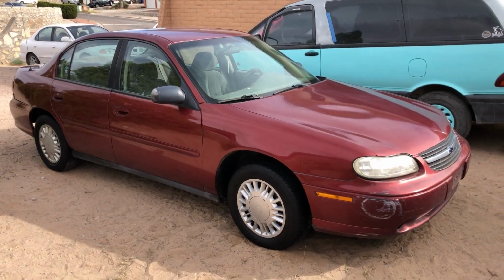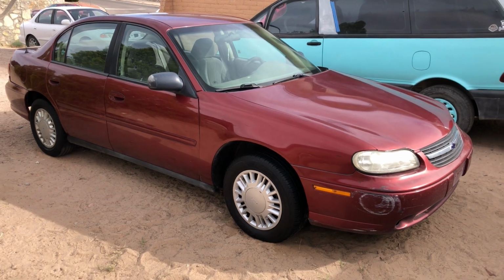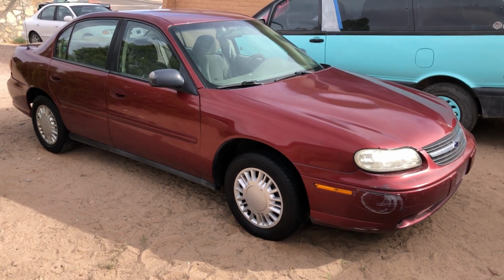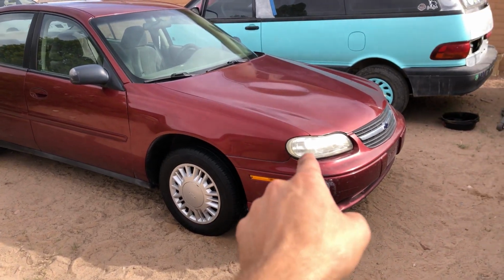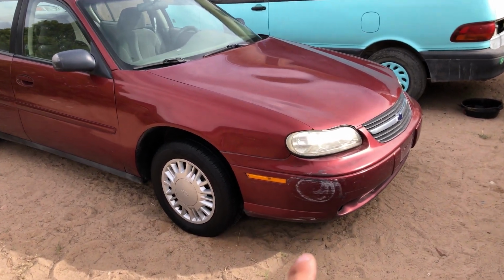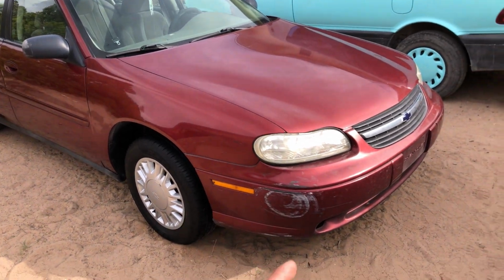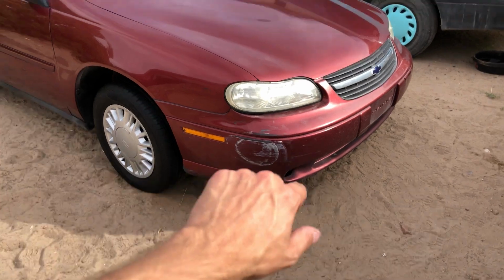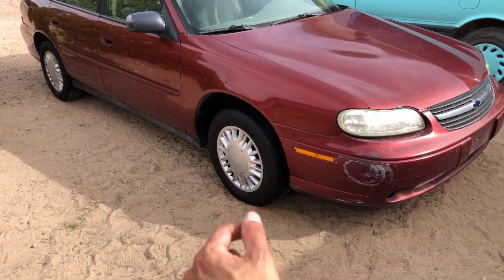Well, there you go, it's done. Both front brake pads were replaced, all four of them. They were good, but I decided to go with the ones that I already had just because I'm already in there. I greased the calipers and the noise went away. I also checked the transmission fluid and it turns out, instead of being underfilled like I expected, it was actually overfilled. Somebody had just unloosened the nut in the past and dumped as much fluid as they could in there instead of checking it the proper way under the transmission with the little nut.